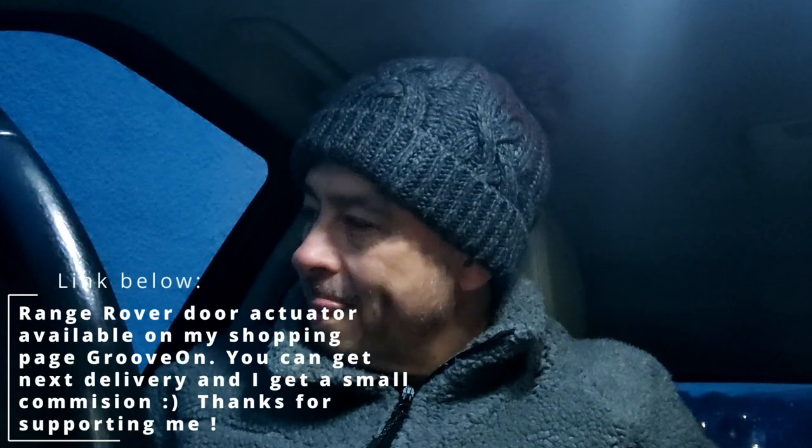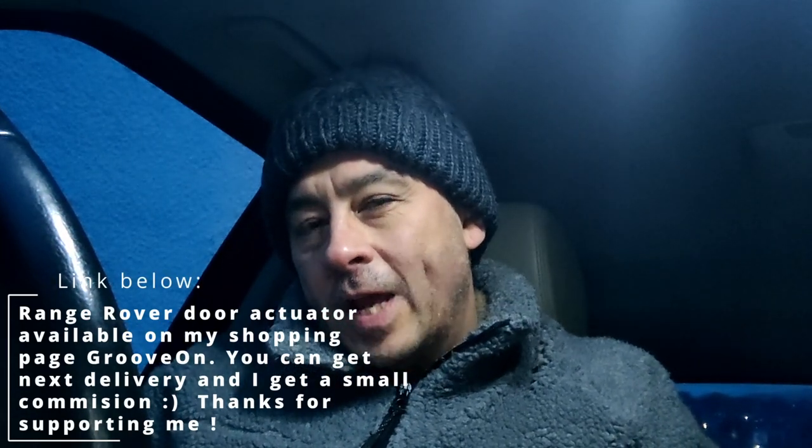So in summary, the little motor inside, when I put the power on in the garage, was actually working. It was working, but it hadn't got the right strength because the little brushes inside were wearing away. And from reading up online, that motor is the most common issue for the actuators. I was just going to buy a new motor for a few pounds, but I think I'll just best get the whole actuator.